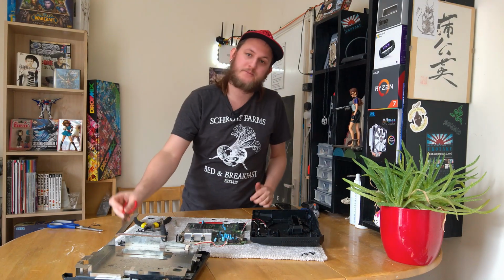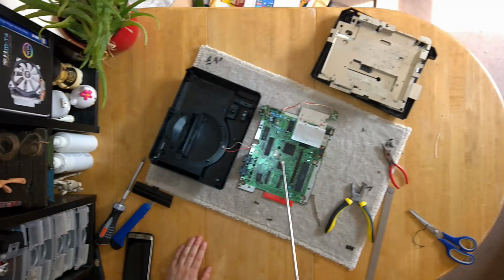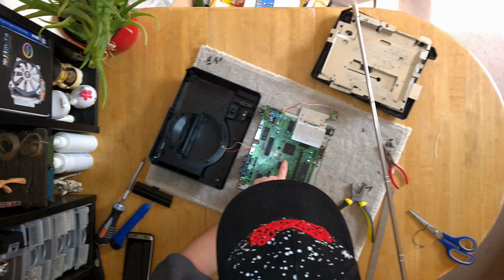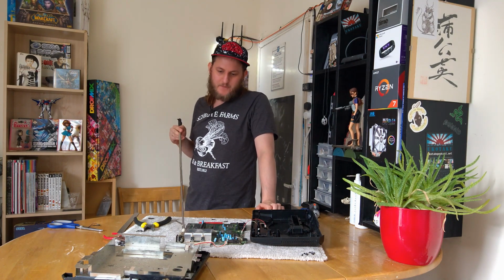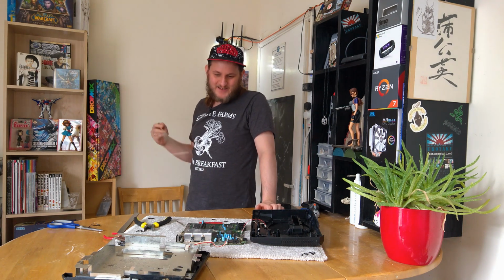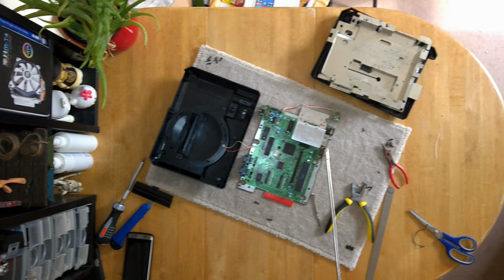So, if you want to help identify what is going on here, we have this broken leg here, which has a resistor attached to it. Got this suspicious looking, I guess this is a capacitor, different type, thing here, which is the only one of its type in here and has obviously been wrapped in non-conductive on one side. Whatever's going on under here, I say looks okay. None of the capacitors are obviously damaged, but we are definitely getting no video output. So our endpoint is here, and what is happening to make that not output could be anything in between here, where the power goes in, which I believe works because the LED works, and every single other component on the board leading to that.